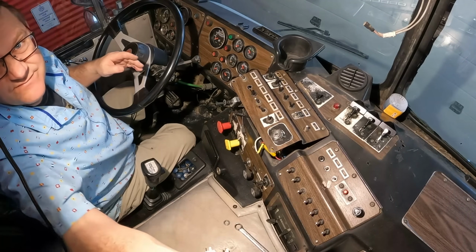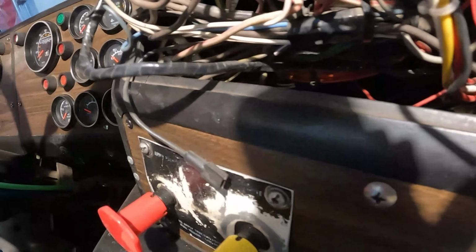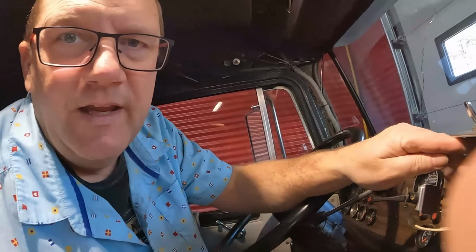See, guys, here's the reason why we've gone to multiplex wiring and all that, but look at how hot that's gotten. So that's why the switches don't last. And even in there, I don't know if you can see it, but there's one that's got a burn mark. So yeah, that's not good. I'm sure there's been a truck or two burn up or have their dash burn up because of that, and that's why the wiring has changed to where it is today, I think. So you have lots of current going through these ones, whereas in the new ones, it's all about reducing the current. And you got smart switches, which I'm not saying it's all better. I mean, if they used that and had bigger wiring, I think it would be better.